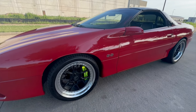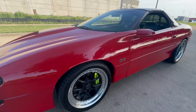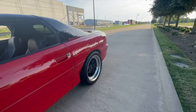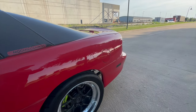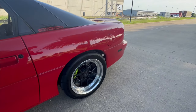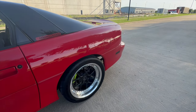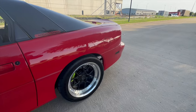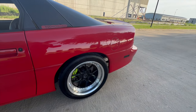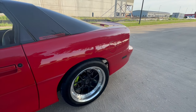Some people will go bigger on the six-piston to fit a 14-inch rotor, which is fine as long as you're running 18-inch and up. I have Toyo tires — Proxes Sport all-seasons on the front for control, and Toyo Proxes R888R on the rear. These are a road course tire, great on dry street or a slightly damp road. The only thing is they give you about five to six thousand miles of good tread before you need a new set. Costly, but probably the best tires I've dealt with — they just wear really quick.